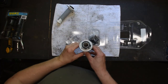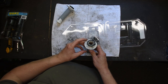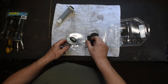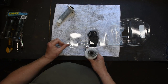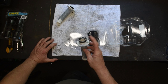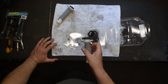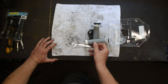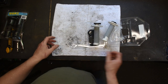Where I ran into a roadblock was the throttle side. The throttle side actually replaces your throttle tube with a new throttle tube, and it comes with an assortment of different cams for different motorcycles and applications. I didn't find one that fit the DR650. I've modified the closest one a bit, but I'm finding the throttle will not return the way I want it to. The original one snaps right back; this one slowly works its way back. So as much as I wanted to use these pillow tops, this particular set doesn't seem to work well for my application.